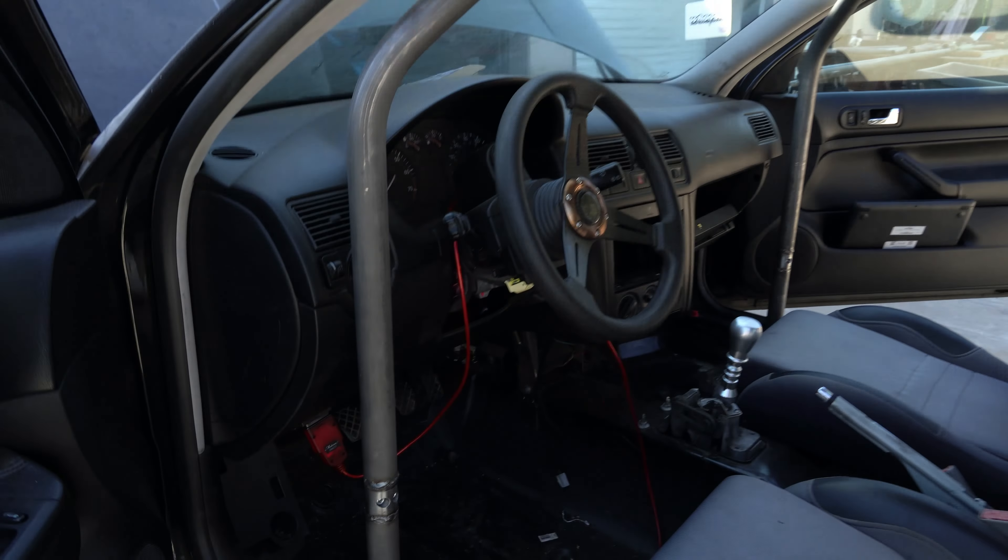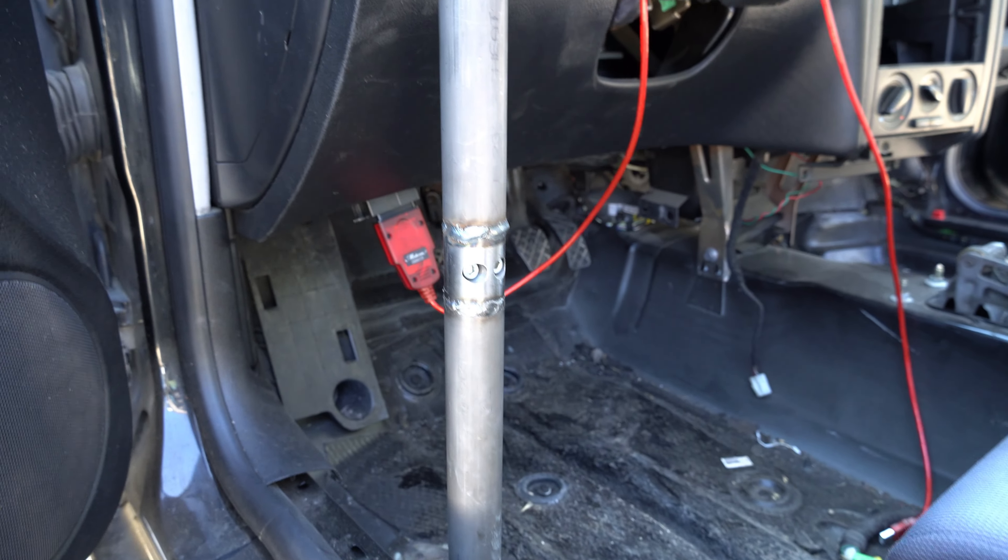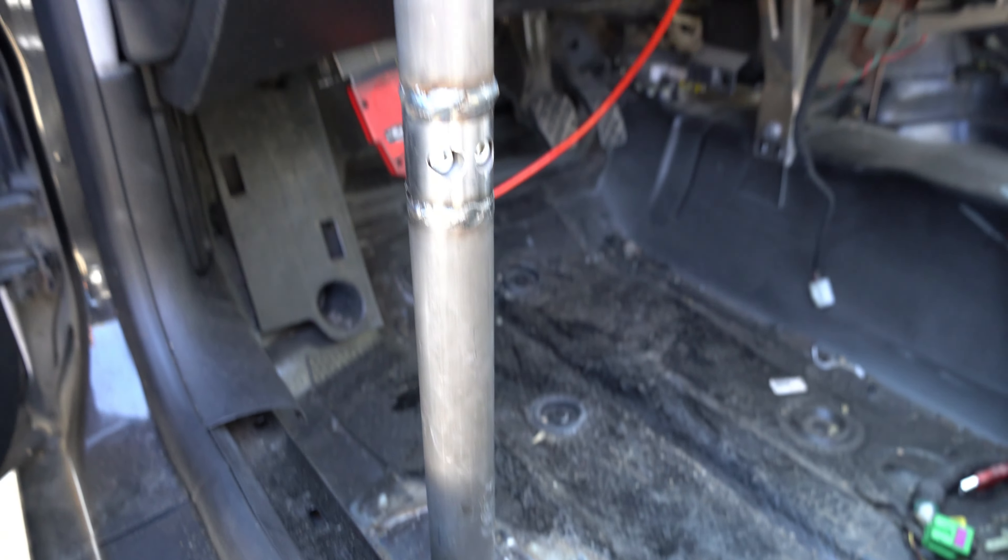We're also running into some electrical gremlins — pretty standard on the GTI — and some boost issues. The boost issue is that it's tuned for E85, but this problem existed beforehand. At wide open throttle it hits boost cut and goes into limp mode with no boost at all. I changed the N75 valve — that wasn't it. Replaced all the vacuum lines — didn't help. Did the SAI delete and N249 delete — still having problems. So I'm going to go into the charge pipes and see if I need to change anything there.